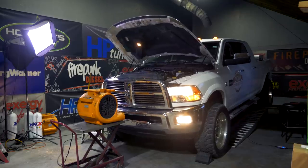One thing I noticed on this truck is how fast this twin setup spools, and we're able to get our air-fuel ratios dialed in on the tuning. I'm going to show you guys how clean we can get this setup — on the 812 horsepower tune it made 1,352 foot-pounds of torque. We could make a little more torque if we really leaned on it down low, but he's looking for ultimate reliability. This will be no foot-braking — I'm just going to roll into it at 100% throttle and let the ECM do all the control on air-fuel ratio.